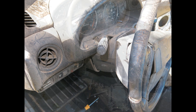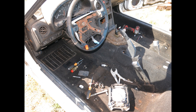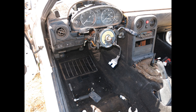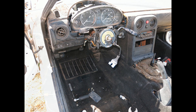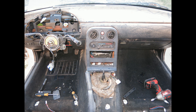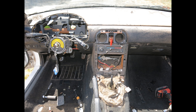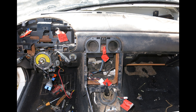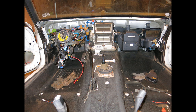Next comes the steering wheel and all its appendages. Then the hood over the instrument cluster comes off, the instrument cluster comes out, and the vent nozzles come out. I'm careful to mark all of the cables that get disconnected from each other, so I know what to plug back in when it comes time to put it back together. And finally, out comes the dashboard.